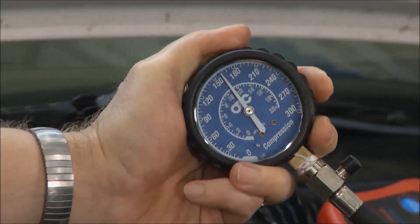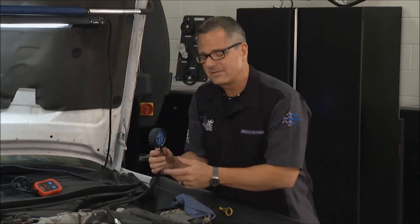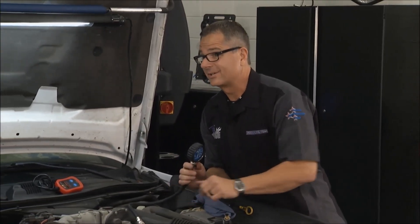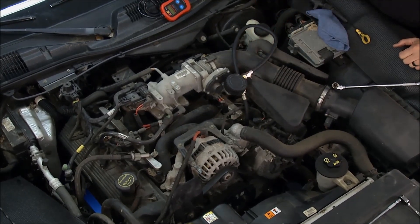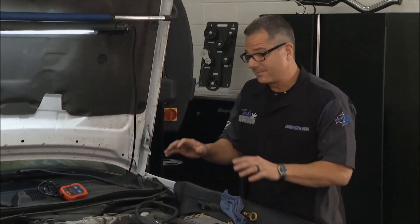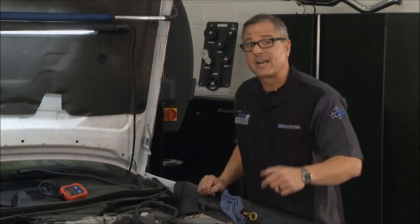I'm going to turn it over about four puffs and we'll see what kind of compression this thing's making. We got up to around 160 — that's awesome. We can check all the cylinders, and it was running pretty good. We got a pretty good platform to start with. I see a few cobwebs and a couple of mud daubers, but nothing we can't fix up. Plenty of parts — we can get them all at RockAuto.com. Now we need to turn our attention to the chassis and the undercarriage.